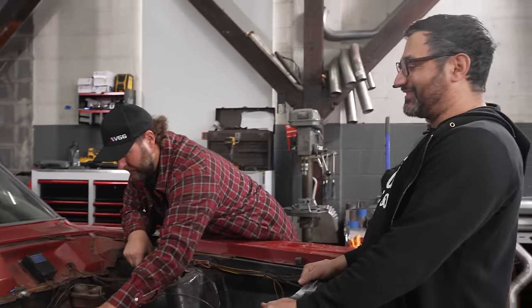This is a hard ruler to read. 3 5/8. Don't forget that. Write it down, okay? Okay, that's A. Done. Now B. All right, now measure that thing to that thing, the mounting face here to that. It's 3.5 right there. We were 3 5/8, correct? Yes. That's 1/8 of an inch. This is 3.5. Yeah, perfect. That's 1/8, right? Well, yeah, .125. That falls right according to the book. It says winner. Winner already. Boom. Nailed it.